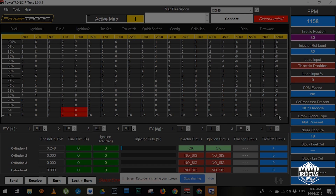So when you're fanging along at high revs and you let the throttle off, you go into decel mode. Instead of 0% fuel, we're getting 25 points more, and ultimately that's going to keep the system cooler and in theory prevent ignition, which will prevent that popping. The popping doesn't really do damage, but it is a little bit annoying on a long trip — it sounds cool, but for a long ride it can get a little bit annoying.